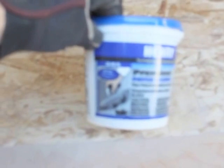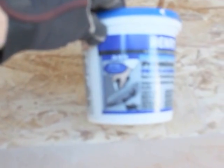So the flooring was off new floor to old floor by a little less than 1/8 of an inch, and the old floor was a little higher. So what I decided to do was use a floor leveling compound and then sand it all down. The product I used was Henry's Premix Patch and Level 345.